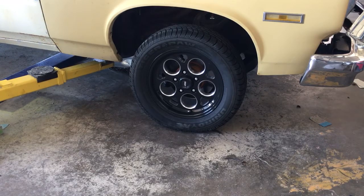I did work on the carburetor, trying to get the idle circuits balanced, because it is just a 2-corner idle carburetor, but the cam pulls such low vacuum, we had to end up cracking the rear butterflies to the 40 thousandths exposure of the transfer slot back there in order to get control of the idle fuel in the front and set our idle at around 950 RPM. So I hope I didn't lose you guys on that, because not everybody's up on Holley carburetors.